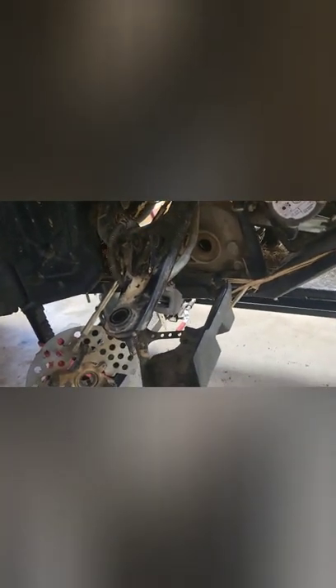So we'll replace bearings and price CV shafts. I already have the rebuild kit for this because my suspicion all along was that it was that. But this suddenly became far more complicated, and I've got to do a little bit of recon to see how to even get this guy out. Obviously the input shaft has to come, but I think that pops out once you get the differential loose. There's a mounting bolt there and one back there. I'm trying to figure out if it comes out the side or out the bottom — there's a skid plate on the bottom we could pull off.